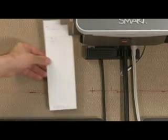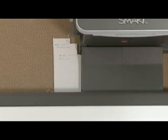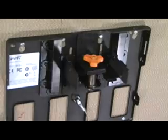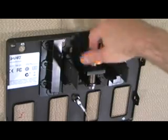If you are using an already installed system, you can easily check the distance from the SMART Board mounting bracket to the projector's wall mount bracket by using a measured piece of cardboard. To simplify things later, now is a good time to use the orange adjustment knob to raise the height of the projector mounting points.